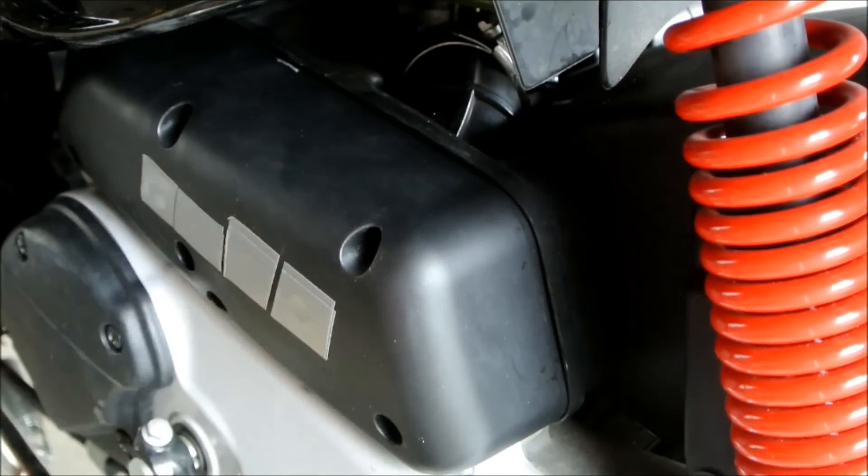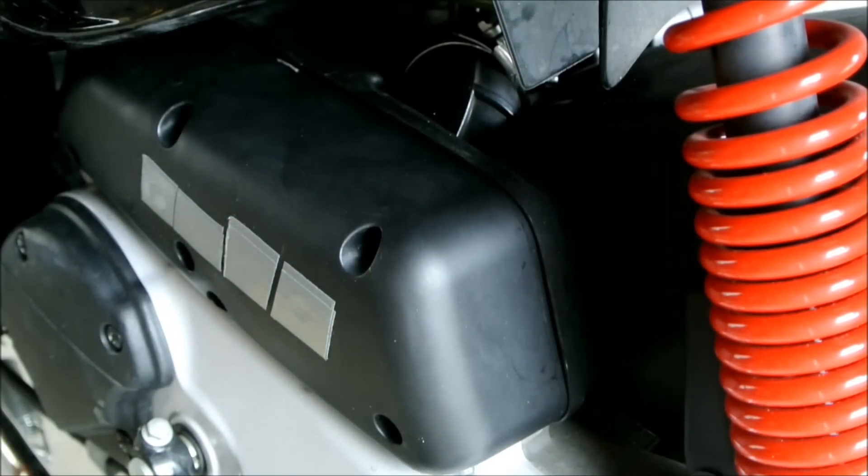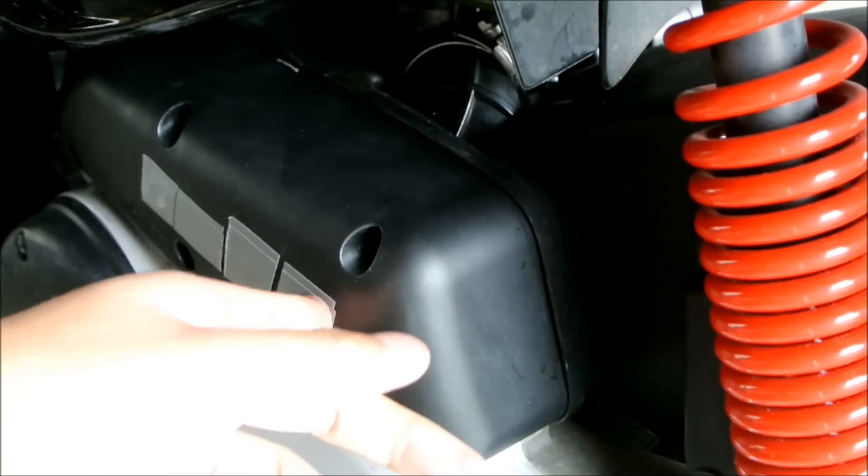The airbox is back on, and the holes are all covered up with duct tape. That's because previously I had a lean issue with the bike, so I'm going to rejet all the way up to a 70 main jet. Previously it was running a 60 main jet stock — thinking it was a 53 main jet stock, I installed a 62 main jet. The bike ran fine but after a while I noticed it ran better with the choke on, which tells me it's running lean — and that is not good for a two-stroke engine because lubrication is part of the fuel mixture. So now I'm going to rejet the carburetor to a 70 main jet and open up the holes one by one to see if it improves or worsens performance.